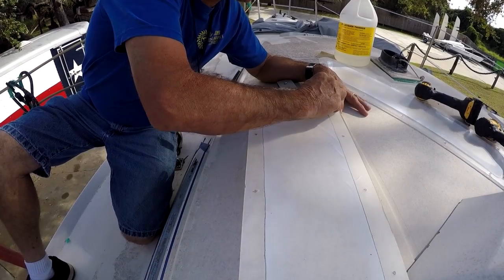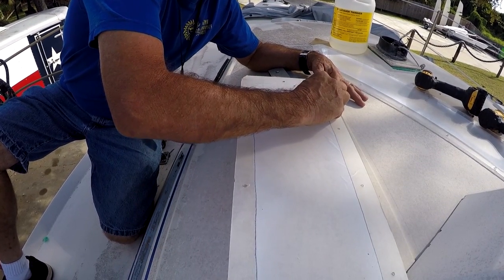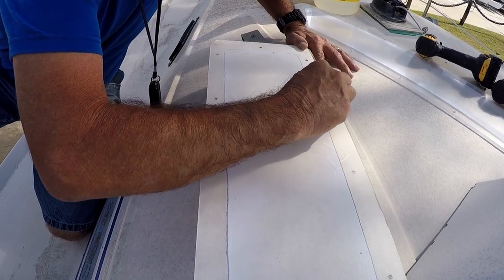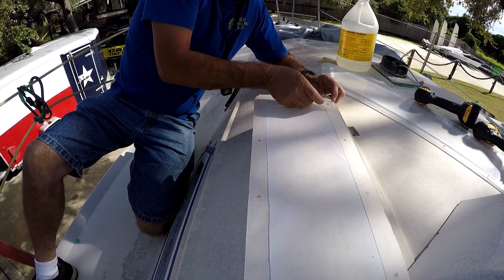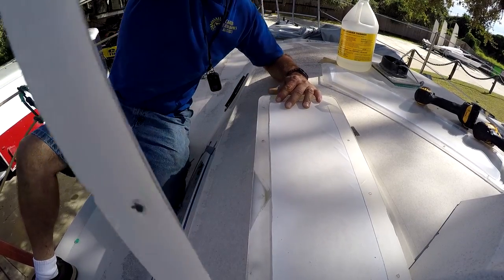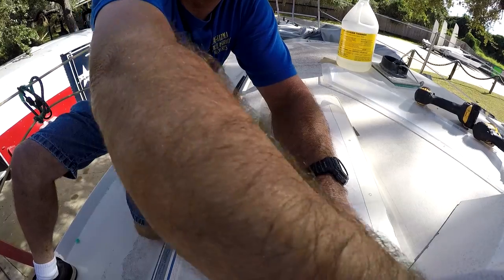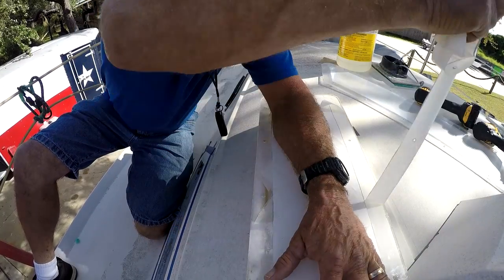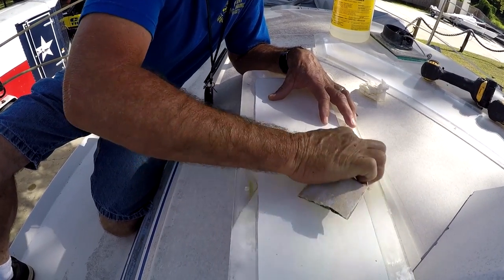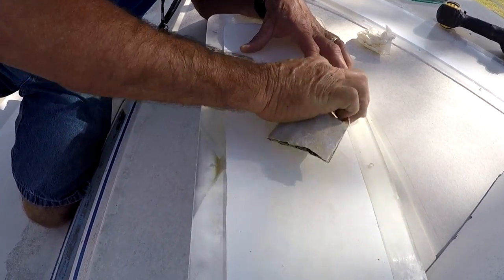After I taped it all off, that's what it looks like. Remove the window and cut out with the razor blade on your pencil line where you marked it from the inside. Remove that masking paper from that area on the edge, then go back and sand that edge with 150–200 grit sandpaper to make the silicone stick very well.